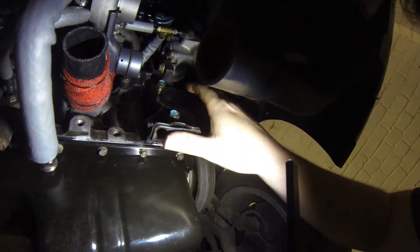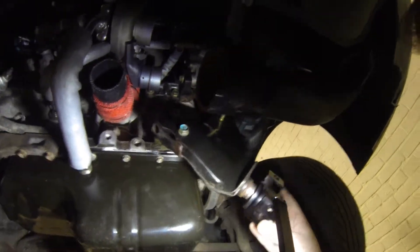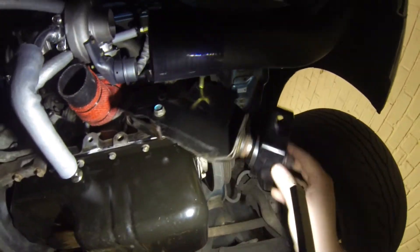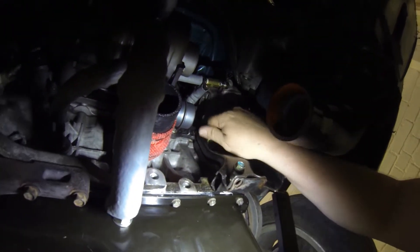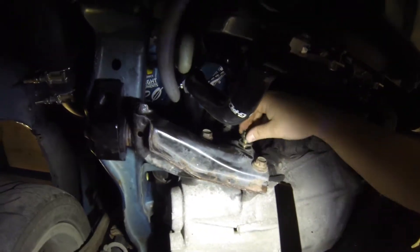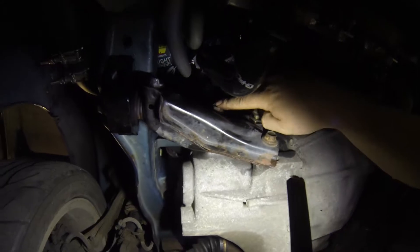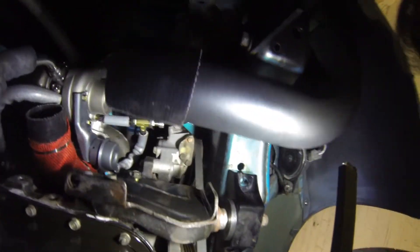What will happen is you'll try and tie it up and it's just going to chew the thread. I undone this bolt here and just loosened this one and the whole arm swung down — I'll show you. Just loosen this one off, take that one out because you can't get it past this bit of pinch. I undone these three — I think they were 17s — took them two out, whole thing swung down. Same again, replace that. This one doesn't have any washers on, and this one I've had to use them too, which come in the kit, to space it to the chassis.